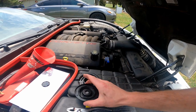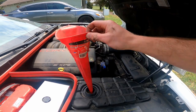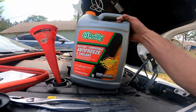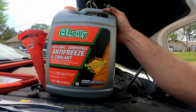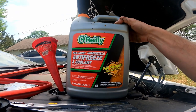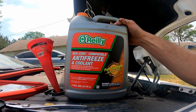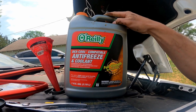So we got a new tank. Now I've got my funnel here and I'm going to use that to help pour in coolant. When you guys are buying coolant, make sure you get the right stuff. As you can see right here it says 'full strength, must add water,' so what you gotta do is have another clean jug that you can mix it 50/50 — 50% water and 50% coolant.